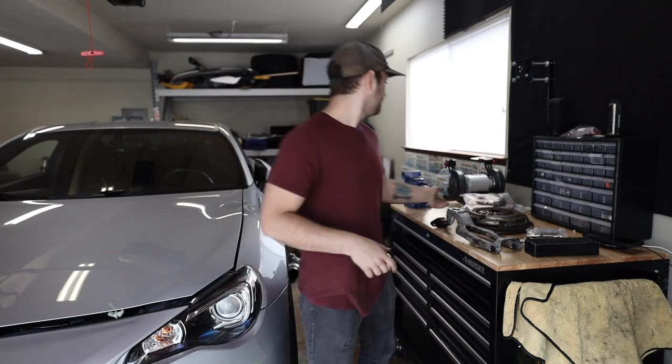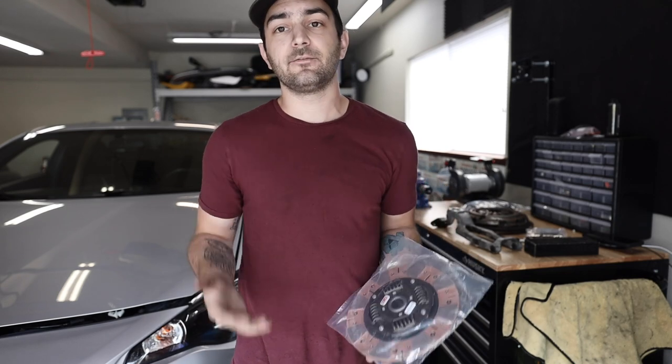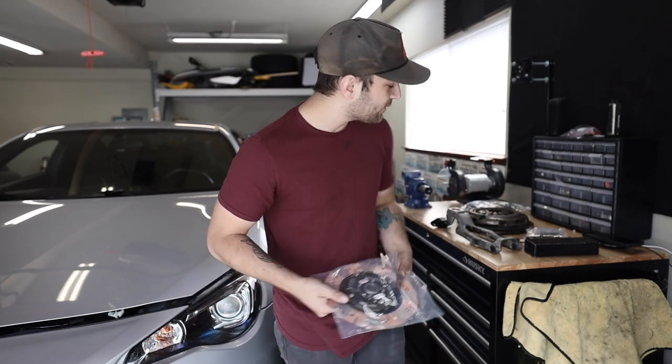Now, if you are looking to upgrade a clutch out there, there are a lot of different options. You can get pressure plates with different pressure ratings than OEM, which is essentially just a stronger diaphragm spring on the pressure plate. You can also get clutches rated for different wheel horsepower or different torque values, because clutches are measured in torque, because that's what the engine puts out. Now, like I said, if you have a clutch similar to this one that is not a full face clutch with material going all the way around it, all of those pads are gonna be rated to different torque ratings. You can have 6-puck clutches, 4-puck, 3-puck. There's a lot of different ones out there. This starts to get a little weird though. And all of those clutches and pressure plates will be rated towards different values.